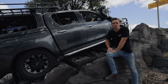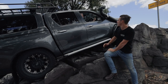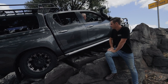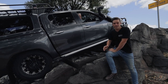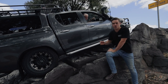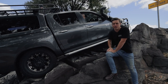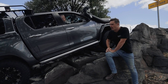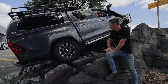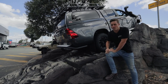That was as far as he managed to get without any lockers. What we're going to do now is throw the rear locker in, which a lot of your brand new dual cabs have, and see how that goes. Even with the rear locker he didn't manage to make it initially, so we'll go back and have a run with the rear locker engaged — a bit of a real-life scenario. And there you go — nice and easy, with the rear locker and just a little bit of momentum he was able to get up the hill.